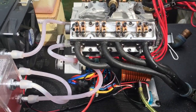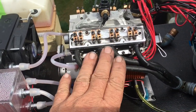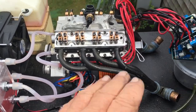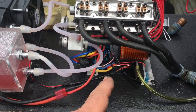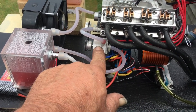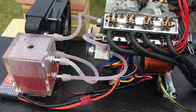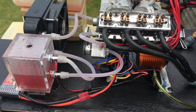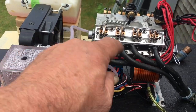There are some things I want to go over with everybody. I bought mine piece by piece, so it didn't come in a kit — I had to make my own igniters, my own exhaust, come up with my own starter motor and water pump. This water pump I bought from Sterling Kit, I'll put a link in the description below. It pushes a lot, and I don't know if it's going to work or not, but we'll find out. Maybe I can put a smaller pulley on it to get a bit more flow.